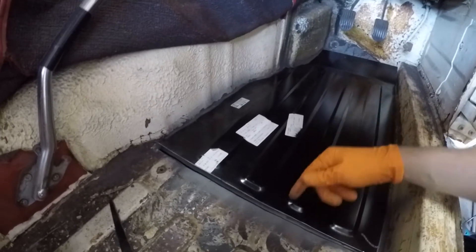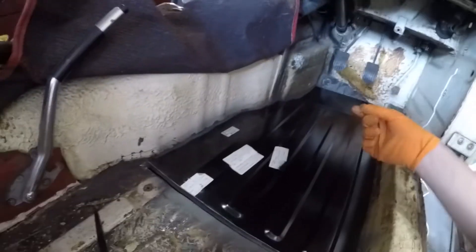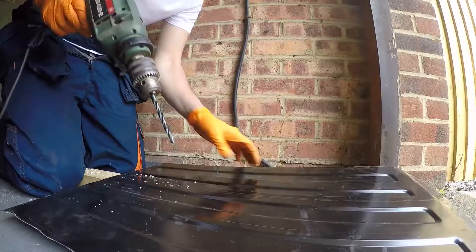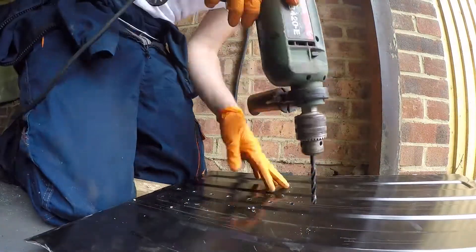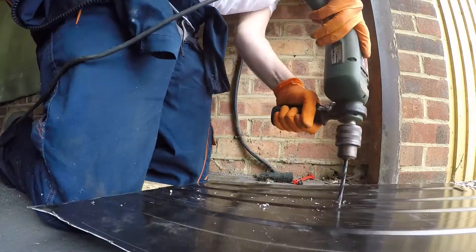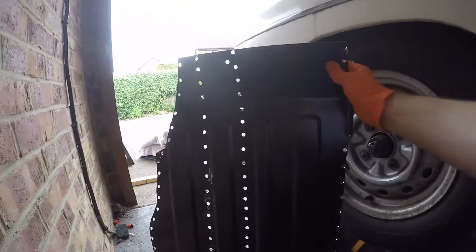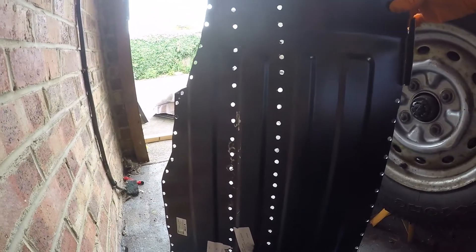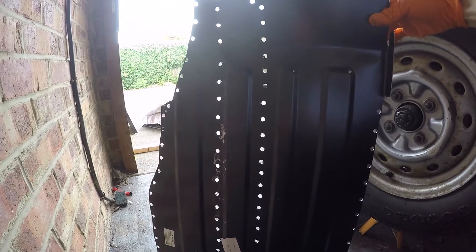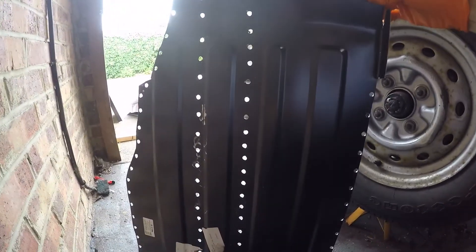I just need to scribe underneath so I can mark out where all the spot welds need to be — the holes where I will then puddle weld. I've just finished cutting all of the holes out to do the puddle welds, and as you can see it looks like it's been shot, but these will be very useful when we start welding because we can weld through the holes and it will form almost like a spot weld.